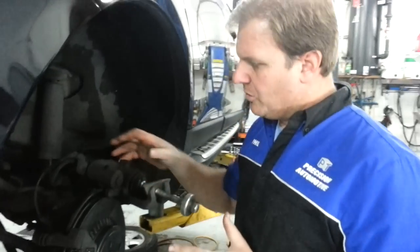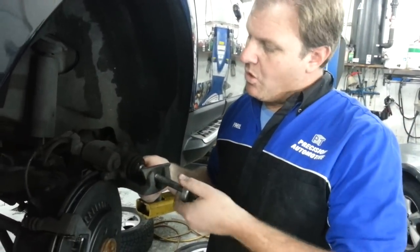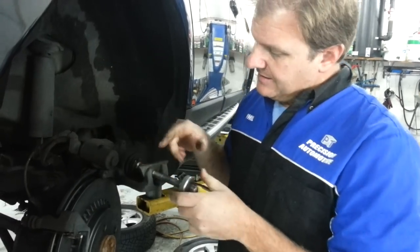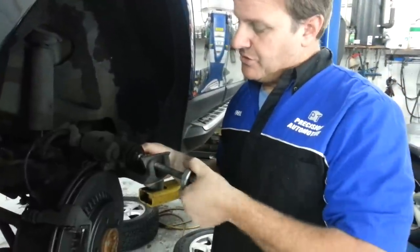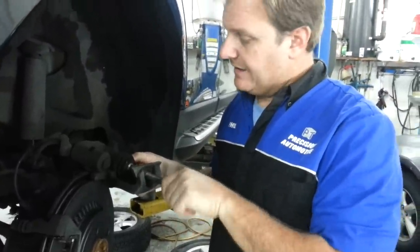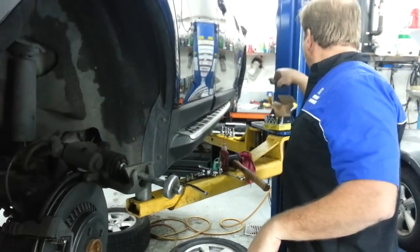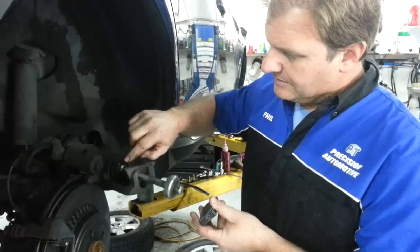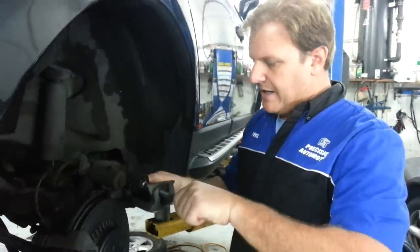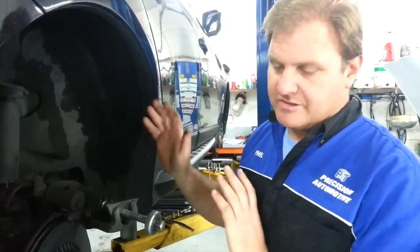The calipers and everything come off as normal. You've got the electronics here — this is the handbrake. The pistons now actually just wind back in, so you can just push them. These sometimes used to require winding in with a special tool, but on these ones we found that we can just push them back, and it's going back quite easily. So we'll just reset all those. There's no locating pin on this brake caliper piston, unlike some others. So we just wind those back in, set them back to zero, put it all back together, and continue on and do the fronts.